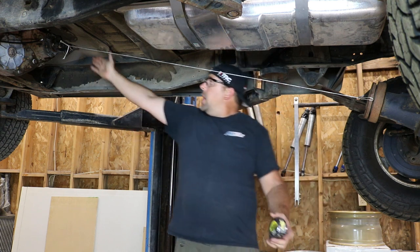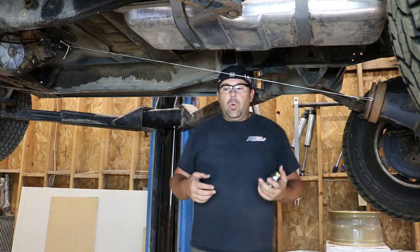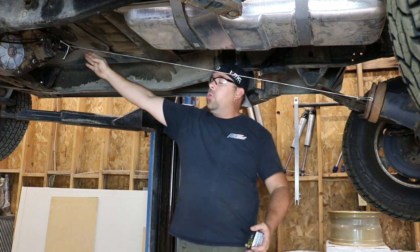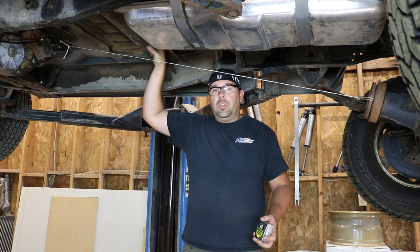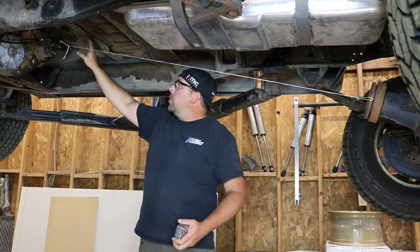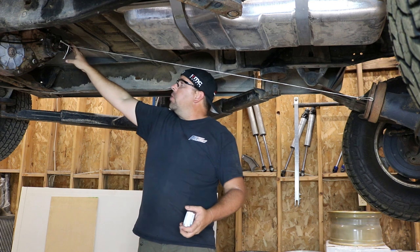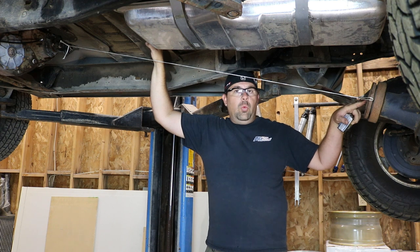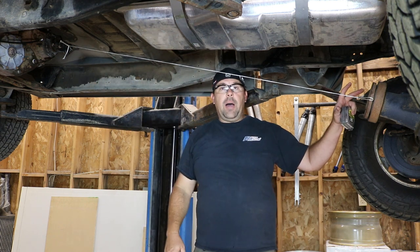This angle has to cancel out this angle. When you go to a two-piece drive shaft, you have three U-joints, so in order to get them to cancel each other out, this angle has to equal the sum of these two angles. We'll say we're going to put one degree between this and the carrier bearing so it has an angle for oiling the caps. We're going to put one degree here, and then at the rear we're going to run whatever angle is here minus one degree. So if this is at five degrees, we'd be at four plus one — this side equals five, and it's the opposite of the front which is five.